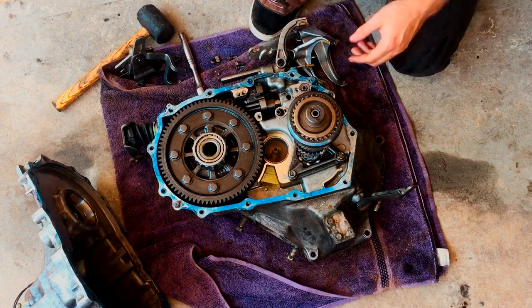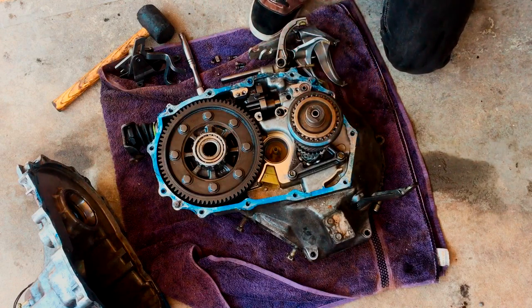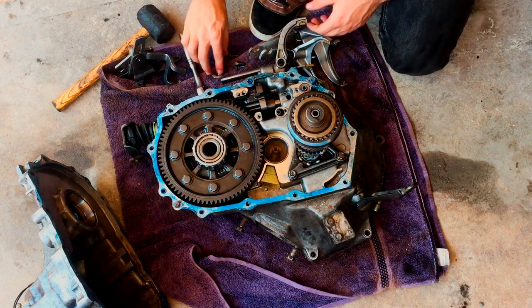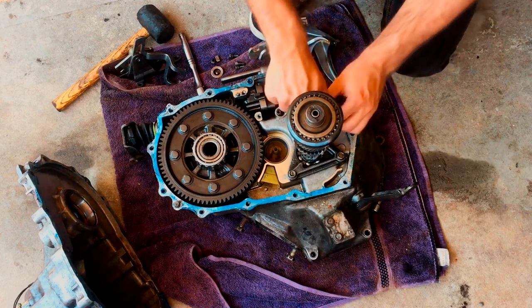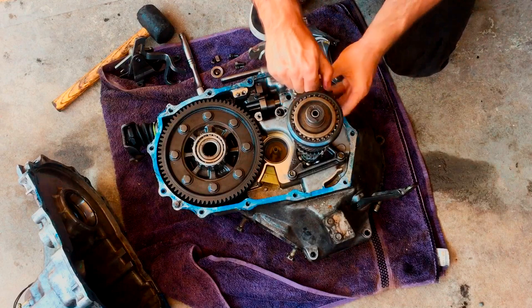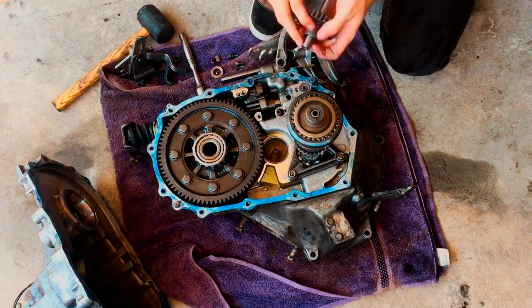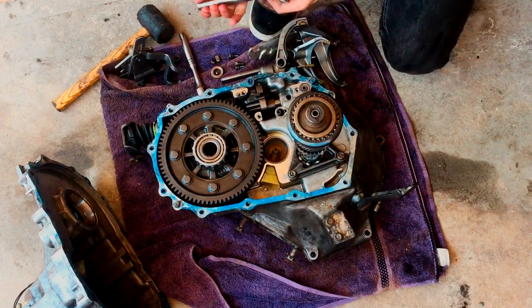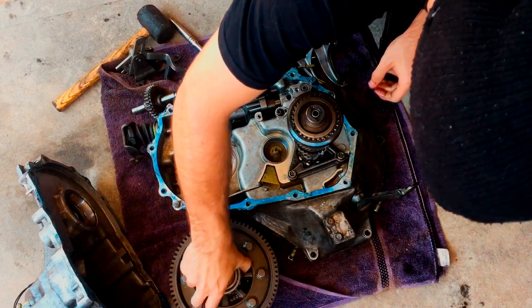The reverse gear has a little washer ring on it, so you want to take that off and put it somewhere safe with those little bearings. The reverse gear also has a little rod in it - just pull that out and your reverse gear will come out. The rod will actually come out of the reverse gear so you can give it a clean up if needed. You should now be able to lift the diff out - put that aside, we'll get to it in a minute.